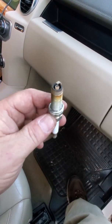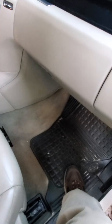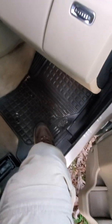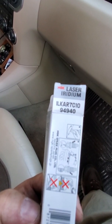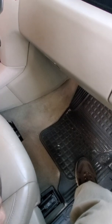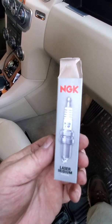So my plug is coffee-coloured and like I said, these all look about the same. These ones are all at 105,000 miles. I'm keeping the plugs just as reference. What I did notice is the old plugs are ILKAR6CY10 and the new ones are ILKAR7C10. So we've gone from 6C on the old ones to 7C10 on the new ones. These are the Land Rover plugs and they're the NGK Iridiums.